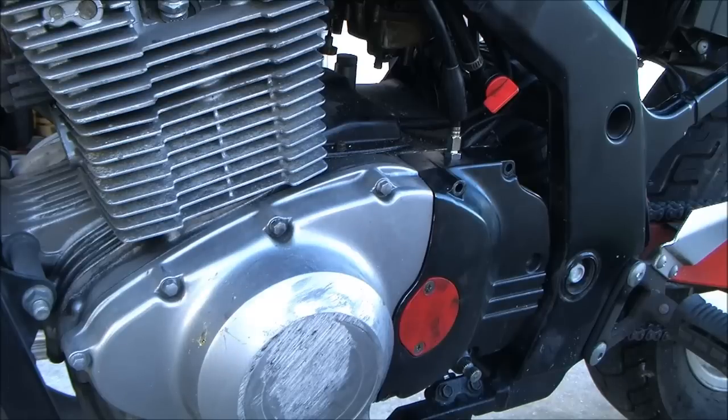Shaft seal for that. It's only like $10. Oh, to stop all that? Yeah. I just bought one for one of the 450s. I haven't even used it yet. If it's the same one, you can have it. Is that bad for the bike, though? It means you're losing a little bit of oil. Probably not very much, but you change it before it does get bad. Oh, okay. And it's like 20 minutes to change that whole seal. Okay. Something we can do on another day.